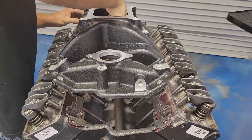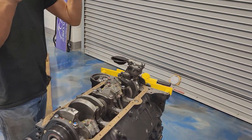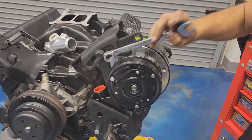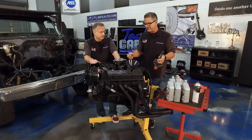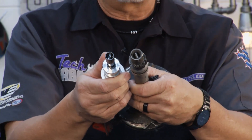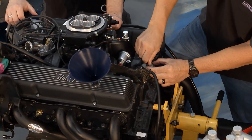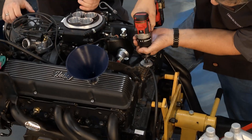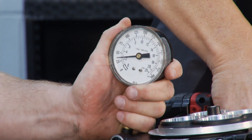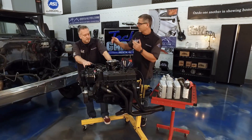The intake manifold is from our friends at Weiand — that's the Street Warrior. They say more horsepower and better acceleration, so why not throw that on there. Flipped it over, oil pan, glued the gaskets — they're cork, so we'll go back and re-torque them, just a normal build. AC compressor goes on and we're good to go. Now it's time to prime the engine with oil — we don't want a dry start. We want to make sure all this precision GPT powertrain is top notch when we get it started. Using a shaft that mimics the distributor, it drives down on the oil pump. Hit it with a drill and watched the gauge — we're looking for about 25 PSI, and we achieved 25-plus PSI. We'll run it for a while to lubricate all the bearings. Great thing to do so you don't have a dry start.